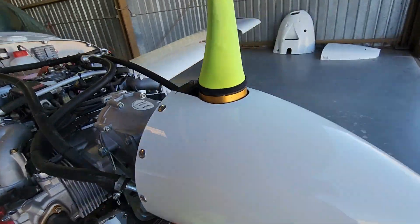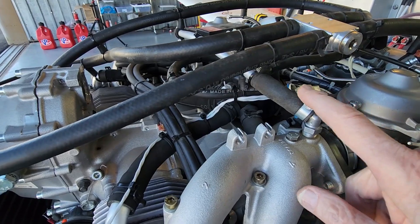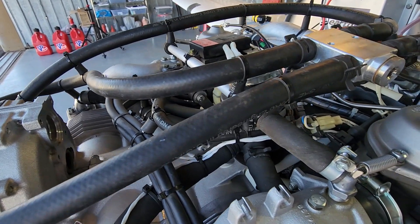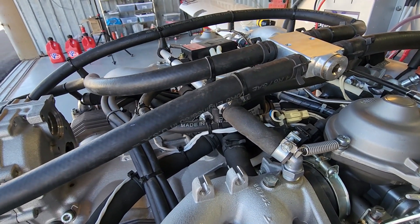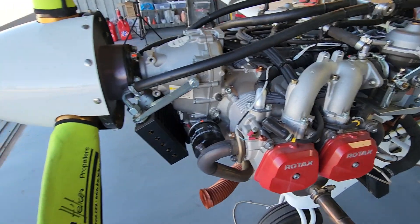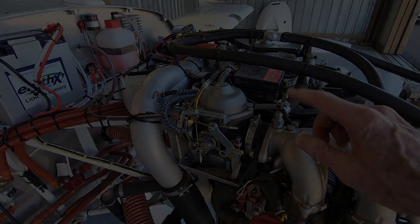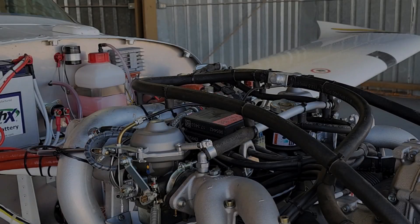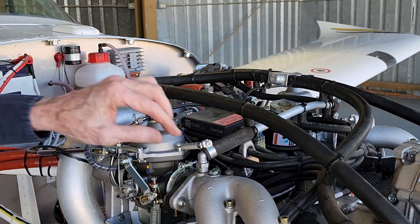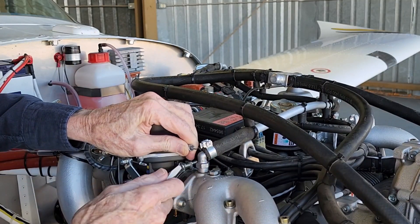I tried this side last week and could not get it off without taking the other side off, primarily because these standoffs on the crossover tube really kept it from coming off. There's a guy named Larry Medrick who said you just squirt some WD-40 and it slides right off — I did that and it didn't work. Anyway, I'll get this set up. First we're going to take this spring off, which sometimes you can do with your fingers, other times it's a little tougher — a screwdriver helps.